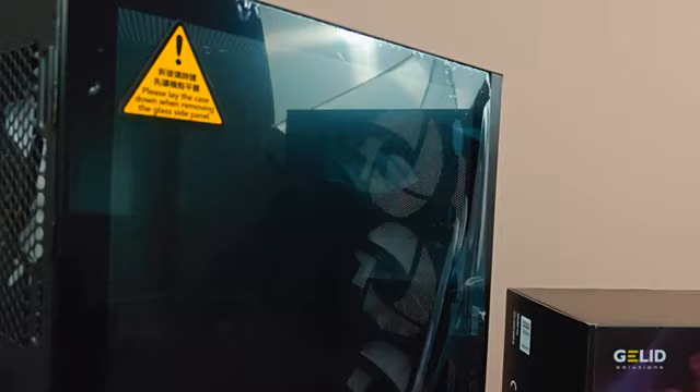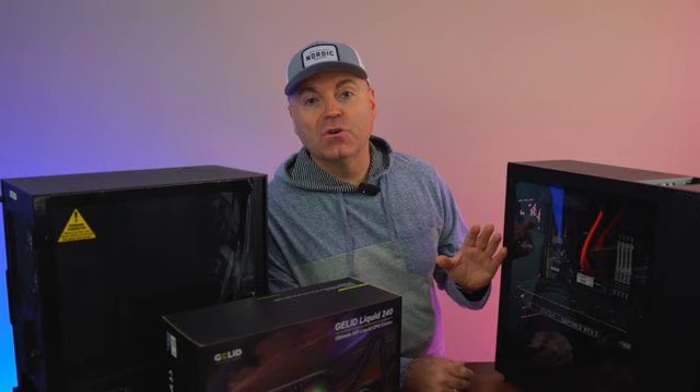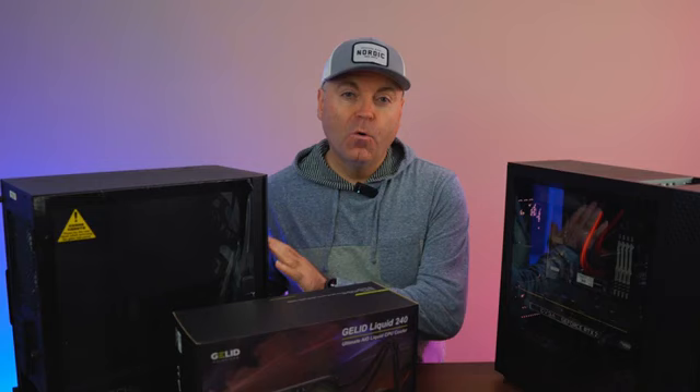The space is not enough — we have only a small exhaust fan and only one 120 pushing air inside. By the way, I'm going to have a future video where I fully modify this case to add another 120 millimeter fan in the front, which is going to require a lot of cutting, so stay tuned for that. But now I'm going to transfer all the internals and run some tests. I'm going to show you the temperature results of the CPU and GPU with the case open, comparing the 120 here and the new 240 from the Gelid.